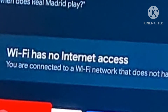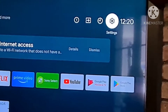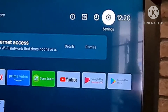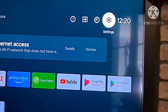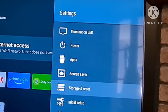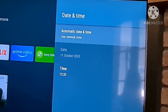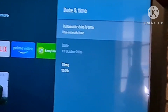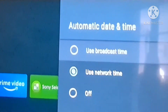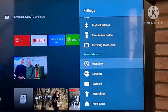What you need to do is pay attention to the top corner of your screen — it might be that your time is wrong up there. So top right, it's saying 12:20. I've just reset it. If your time up there is completely wrong following a power cut, go into Settings, then go down to Date and Time, and on there make sure you've selected Use Network Time. As soon as you do that, all of your problems will disappear and you'll be back online.